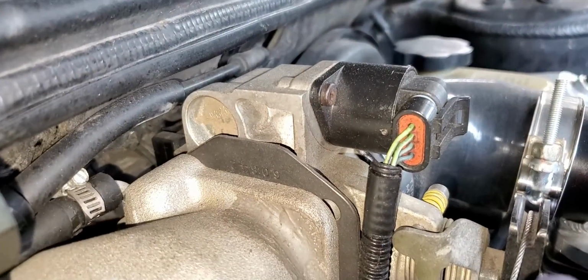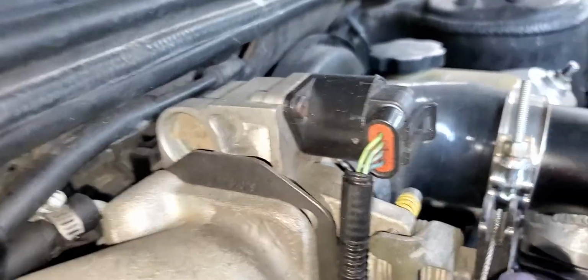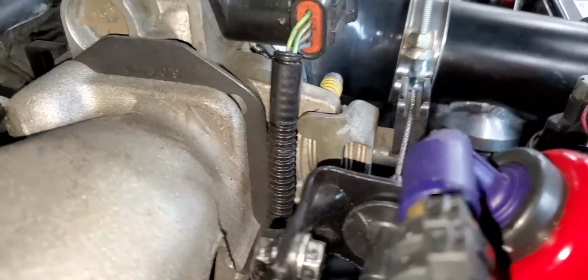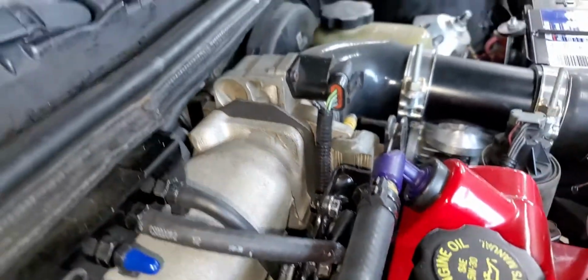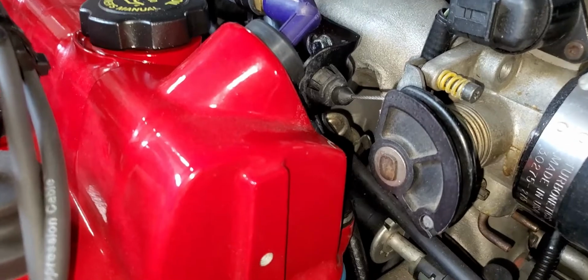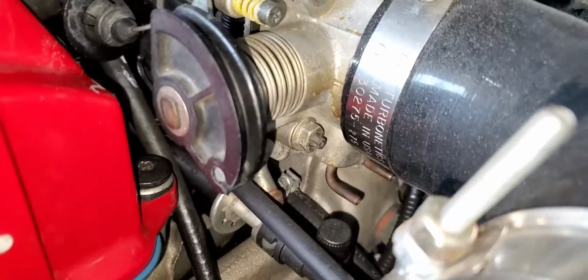That's the Geo Storm throttle body. It's the bigger engine one, so it is physically bigger. If you just get the single overhead cam one, I think it is, it's the same diameter. It's bigger mouth, but it tapers down to the same diameter as the stock S series. You don't want that one. You want the dual overhead cam one.